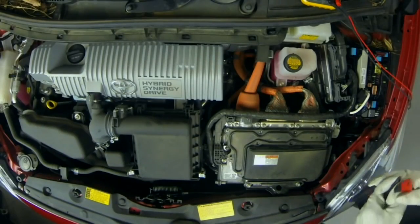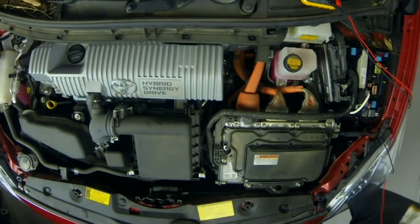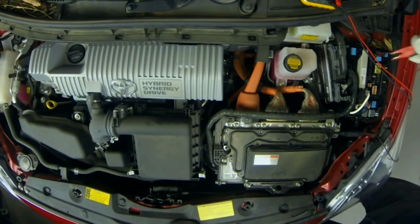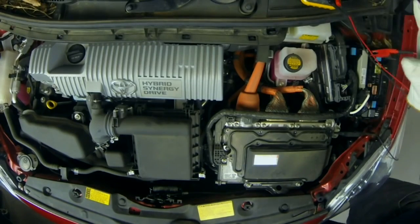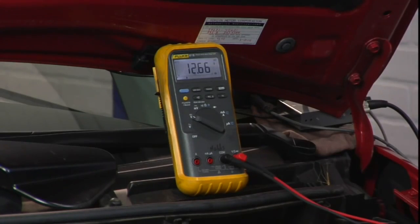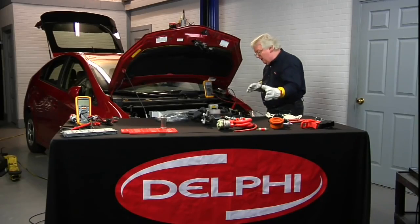What we'll do is go ahead and get a known good ground, then go to something we know is good power — like this jumper bar on this bus electrical center. If we see 12 and a half volts, we know the meter is working. We don't have an auto-ranging issue, connection problem, or a blown fuse causing the meter to not function and show zero when it needs to be showing live voltage. So 12 volts is fine — that's harmless.